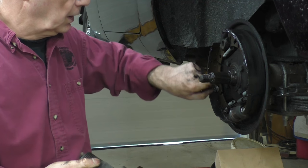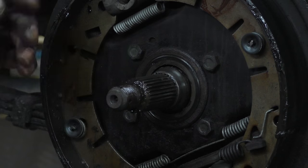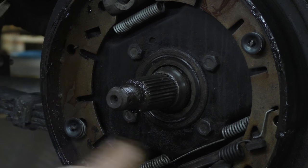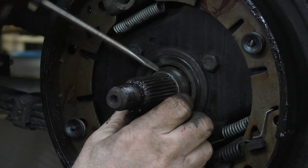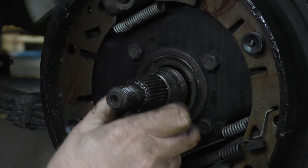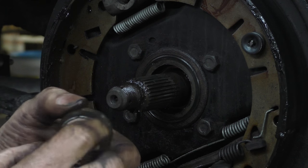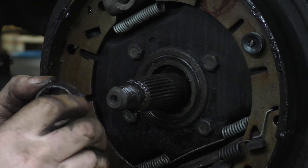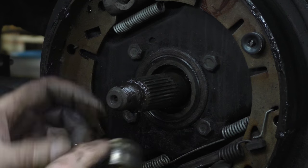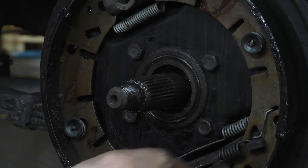Now you can see the axle is exposed and you can see our oil seal. Instead of removing all the rest of the bearing assembly, I'm going to try to get the oil seal out without doing that. First thing I need to do is this collar that runs on the inside — I'll see if I can get this to come out, which I can. There are slots in it so that when the hub is against it, it pushes on the slot and tightens this piece on the shaft. If you push a screwdriver in the slot and just turn it, you can slide it out. Now I'll be able to get a screwdriver behind the oil seal a lot easier, but first I'm going to take all the brake shoes and everything else off.